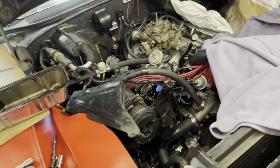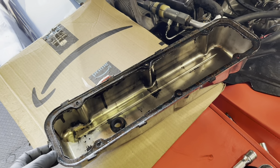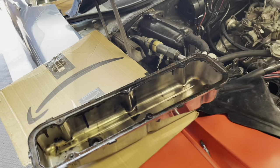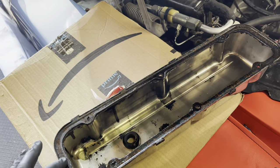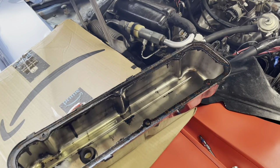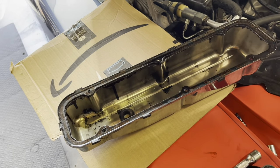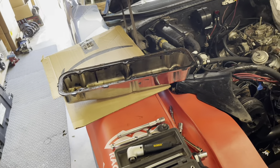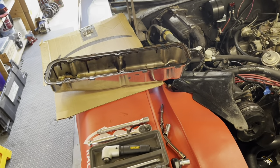But since I already had a lot of stuff off, I was like, what's another three bolts? So I got it off — it was a little bit of a pain, especially over by the AC box bottom corner, which is always a pain on these GM cars. What I think I might do is go ahead and clean it up, then scuff this part with some light-grit sandpaper to roughen it up — not so much to take off the chrome, but just to give the gasket sealant a good tooth to stick to — and then put the gasket down. I got new gaskets sitting over there, so I'll wash them, clean them up, let them dry since it's sunny outside, scuff them up, wipe them down so there are no contaminants getting in the oil, and then install them back in.